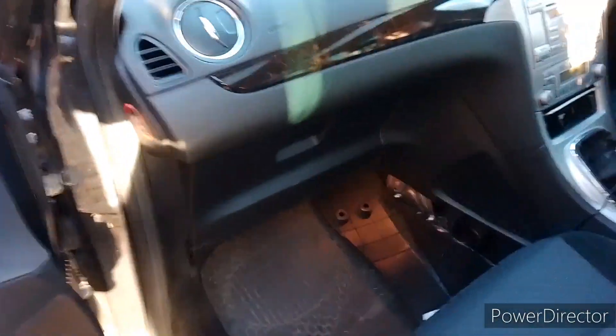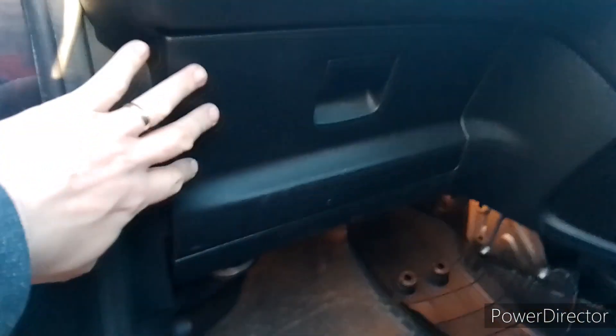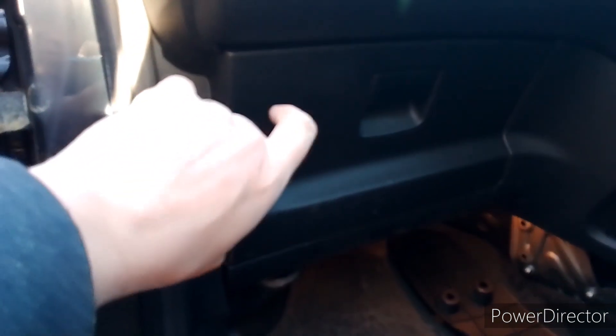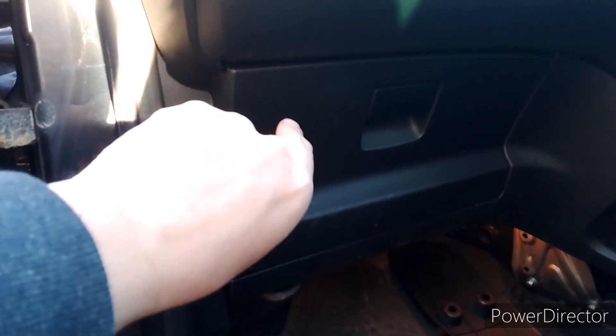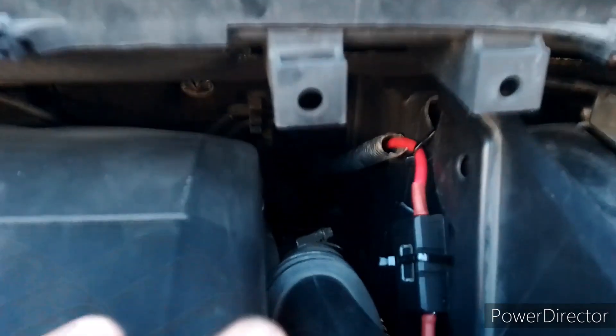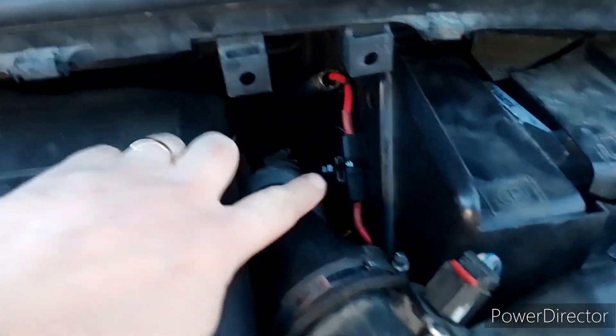Just to recap: cables come all the way down the front. I didn't actually have to take the dash out — when I watched the video back I realised I'd screwed up my commentary. What I actually had to take out was the glove box, which had about five or six screws plus three bolts. I also had to take these panels out to get at the access screws. Behind there I had to cut part of the soundproofing away, then drill a hole and put a grommet in so the cable goes through. The problem was the cable just wasn't quite long enough to reach through to the battery compartment. At the front, it comes through into the engine bay and we put a bit of trunking over the top for extra protection because the turbo's down the back of the engine.